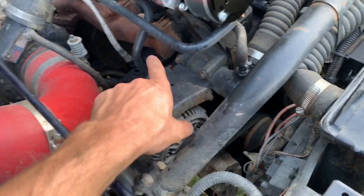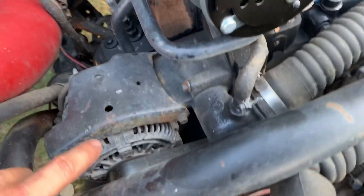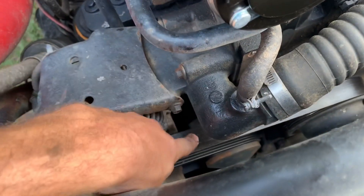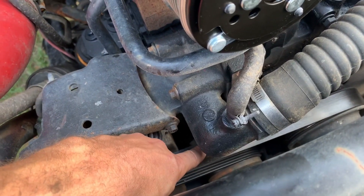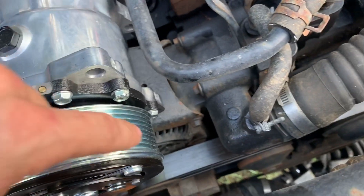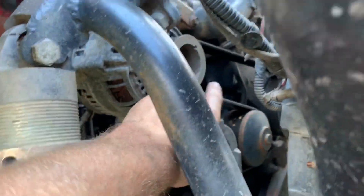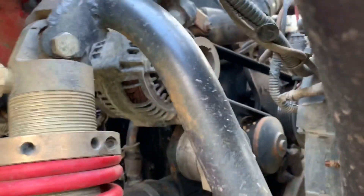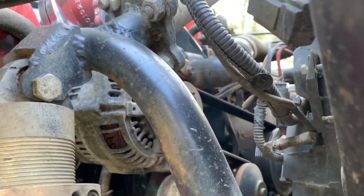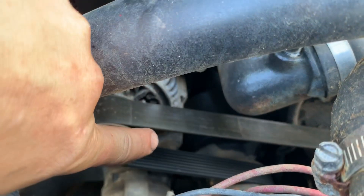You can always hack this and pivot your alternator farther down, then sink the compressor in this spot and build some sort of mount off the two halves. If I go this route I'm going to have to build some sort of idler pulley underneath the water neck so the belt clears — it'll be sitting here and it's going to want to come right and hit there, so you'll need some sort of idler pulley. There appear to be several bolt holes down there to make some sort of brace bracket.